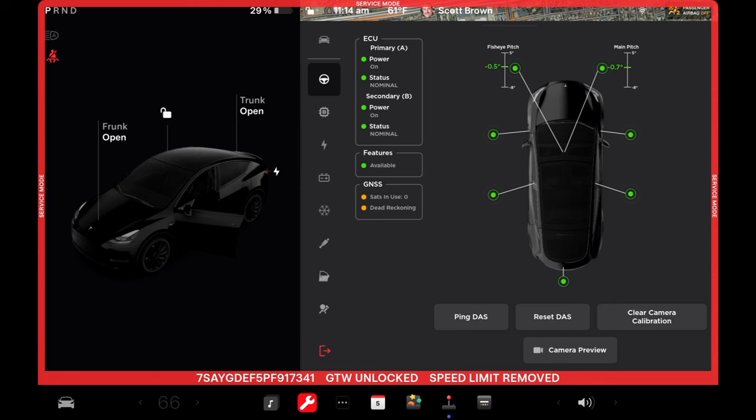On the left panel we see the ECU primary A and B statuses. When they're green icons, everything's available. Below that we have satellite data — this vehicle has been sitting inside the building so we currently don't have any satellites in view. Normally you'll see nine or more, sometimes twelve, and there will be a green indicator next to dead reckoning. One word of caution: I've had some different equipment in my car to collect data and it affected that satellite accuracy. When I had that interference problem, everything was green but only one satellite was in use. Unplugging my equipment re-enabled all that data.